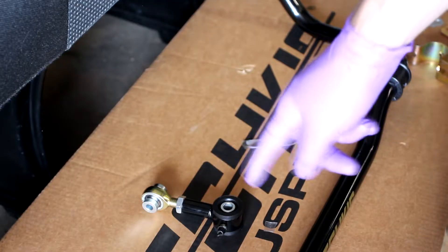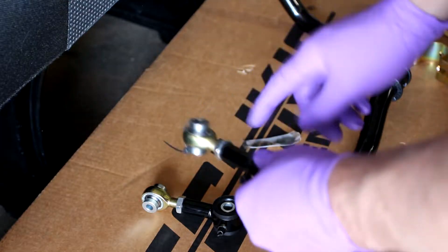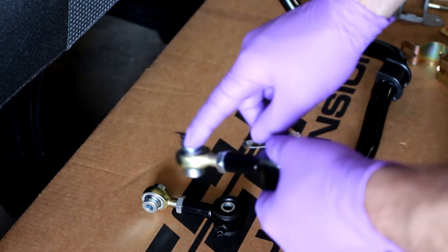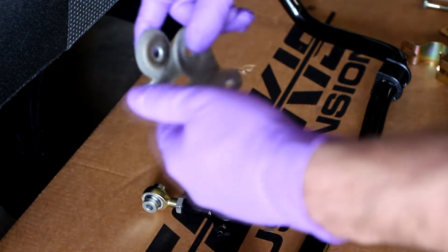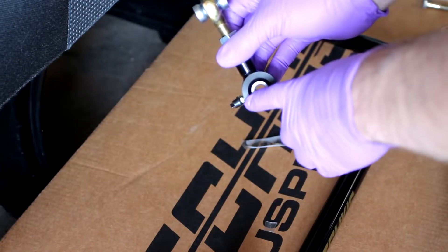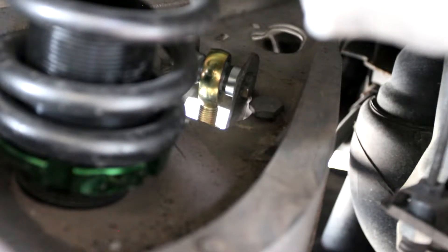Now that we've got those guys on, we're going to jump over to these end links. This is going to be adjustable, kind of like my rear lower control arms. This nut right here is an 11/16ths — yes, once again aftermarket going with imperial instead of metric; I don't know why. And then there's two spacers on each side. What you're going to want to do with these guys, because they install in the car separately, is install these brackets on there. When you take these off the car, you're going to notice that one side is to the inside of the car and the other side is to the outside. So just make sure you keep that orientation. Another thing to note: the fill cap here is supposed to be pointing to the back of the car. Now we just need to put the mounts in — the easiest way is to drop the bolts in from the top, then go underneath and push the mount in from underneath, and then secure it with the bolts. Once secured, come back up top and tighten everything.